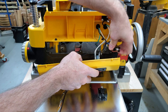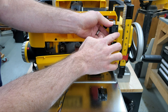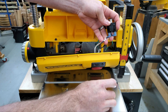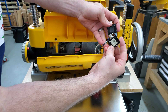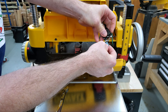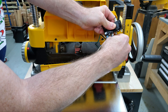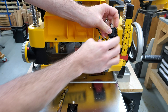And that's it — you have now accessed your breaker. Before you put the new one in, notice that it has a line side and a load side: the line side comes from the power source like your circuit panel or electrical outlet, and the load side goes further into the planer. As long as you've properly marked your replacement, pull off one wire and stick it in the same place, then pull off the other side and put that over. That way it's a one-for-one match and you don't get confused.